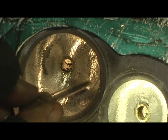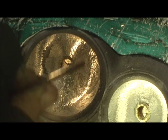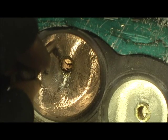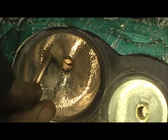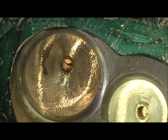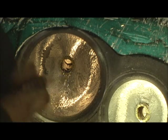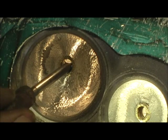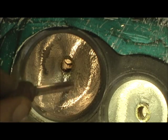You've got to make it kind of like a pyramid — I've got plenty of fillet radius right here and at the back. You kind of cone-shape it and you can dig so far up in here. This thing's going to have a hell of a high-lift cam in it, so you need the strength. I'm right there at a crossroads, so I'm going to leave it like that because I know I probably picked up 20 numbers just in this one modification at mid and high lift flows.